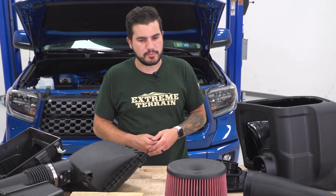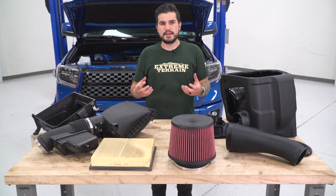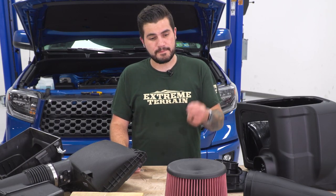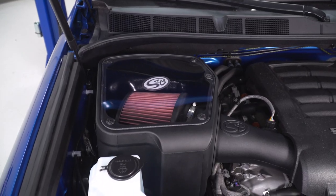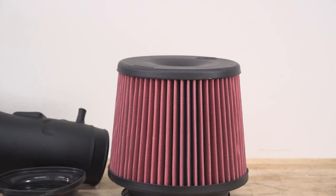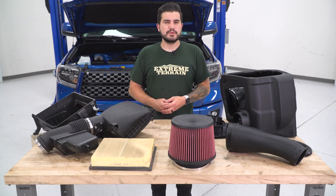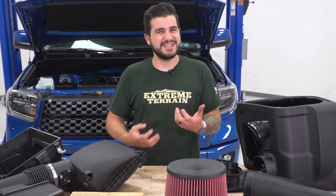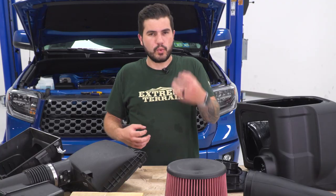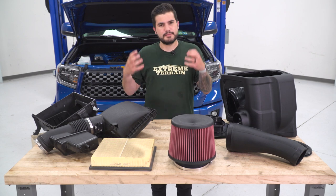The dry paper element isn't really seen in the aftermarket — it's usually a dry cotton gauze or synthetic material. Oiled versus dry filters are within 1% of each other in terms of performance — almost completely the same. It's just a matter of application. The oiled filter requires a little more maintenance: pop it out, wash it, re-oil it, and it's good for up to 100,000 miles. If you're in a dry climate with a lot of air pollution, like a desert climate such as Arizona, a dry filter might be better since the oil attracts microparticles and you'd need more frequent maintenance.